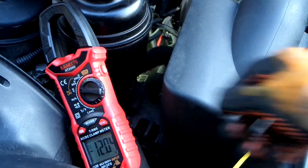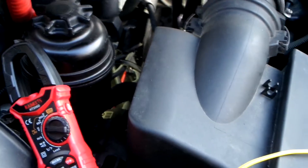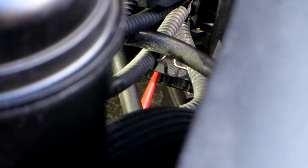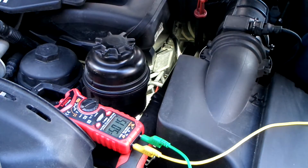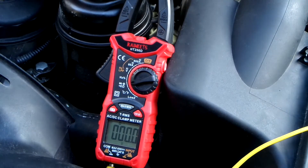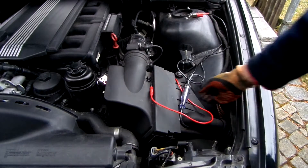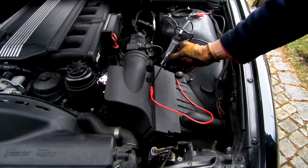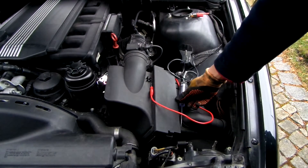Let's check if our wiring is in order. On pin 1 we've got 12V. On pin 2, 5V as expected. And there is no resistance between pin 3 and ground. Just to be sure, we can also check that there is no weird voltage drop. Since our test light is bright when connected to pin 1, we can say that everything to the connector is okay.